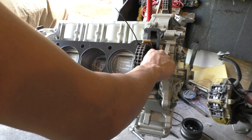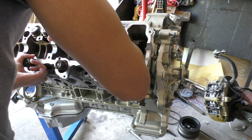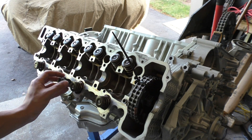So just to be on the safe side I applied some sealant on some critical areas. After that it was time to put the heads back on — just make sure it clears the timing chain and goes on the proper alignment dowels. After that I put some assembly lube on the head bolts and inserted them in place.